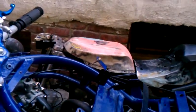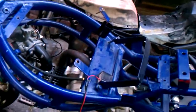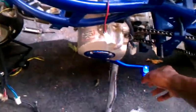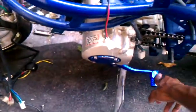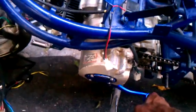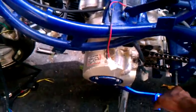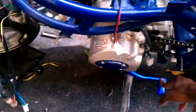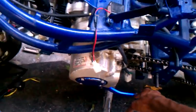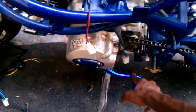Every time you want to switch gears, you grab your clutch and you click up — that's third gear. From there you click up again while you're grabbing your clutch — that's fourth gear. So then you'll be in the highest gear, which is fourth gear. When you're in fourth gear and you're trying to slow down, same process — you step on your brake, you grab your clutch, and you shift down. That'll be third gear. Then you shift down again — that'll be second. And you shift down again — that'll be first gear.